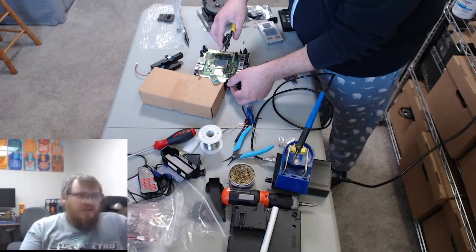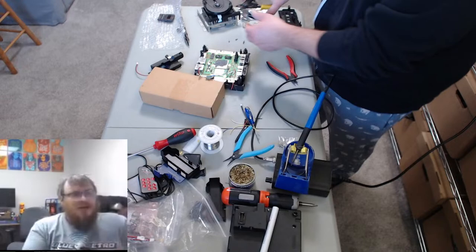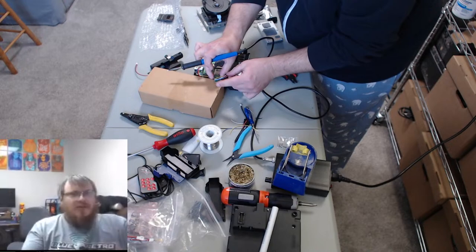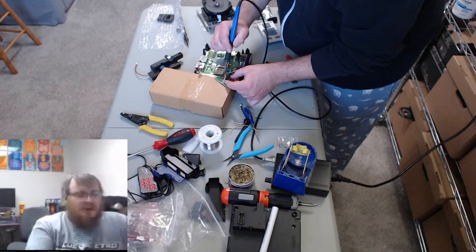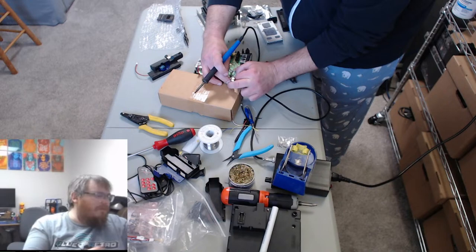One of the things I'm working on for the Dreamcast Blue Retro board is a LIR2032 battery charging module. So you'll be able to use an off-the-shelf LIR2032, which is a lot easier to get a hold of than the ML2032s. And for the most part, it'll be a lot more stable. I'm still testing the charging circuits that I've built for it, because it won't be charged by the Dreamcast's internal charging circuit for batteries. But in early testing, it did work as a replacement for the battery in the console.